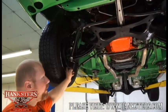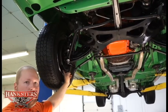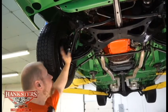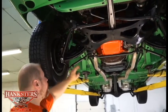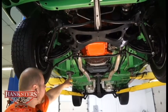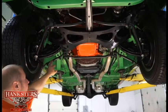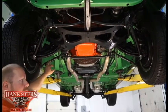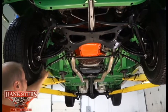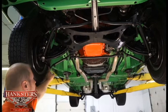Inside of the wheels here, again, we've got drum brakes up front as well. But again, these were power drums, so drums the whole way around on this car. Front suspension, again, all stock stuff. So your lower control arms, those torsion bars going back there to the center of the car, all of your front steering components. These look to have been all pretty new on this car. Again, your tie rods, all the little rubber boots on those, the dust covers, those are all intact.